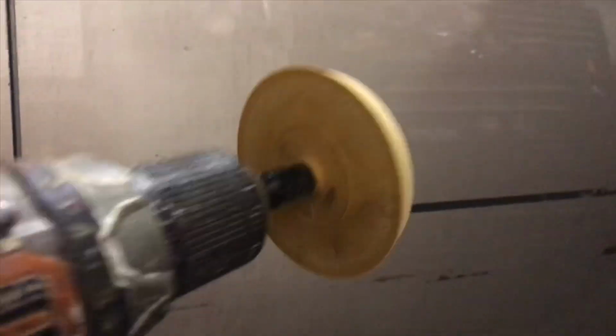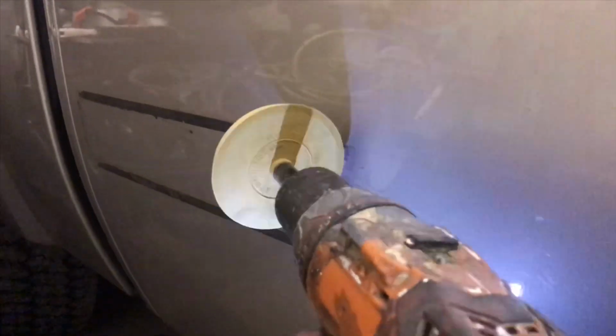Okay, so the next step, you're going to be left with this ugly VHB black line here. You're going to get yourself one of these rubber wheels. I'll put a link below. I have another video about these for removing vinyl or stickers or lettering such as this logo. Awesome tool, very cheap, like $6 or something. Napa also sells them, but essentially what you're going to do is run this back and forth.